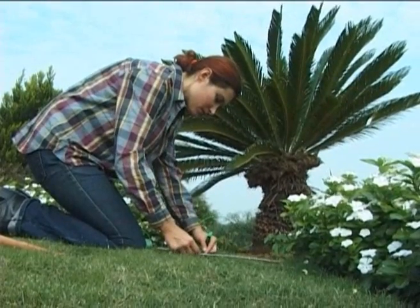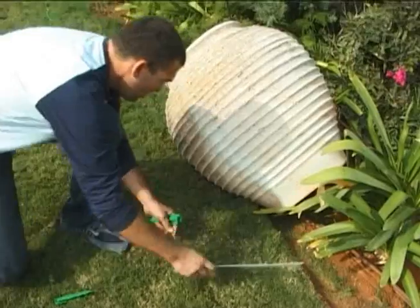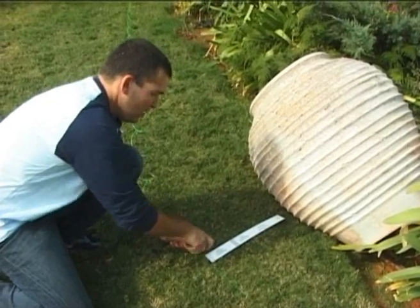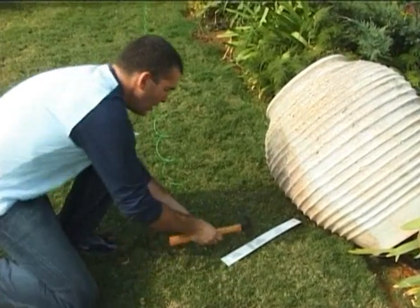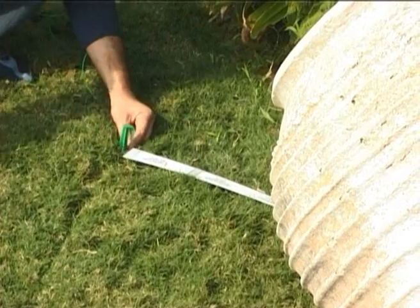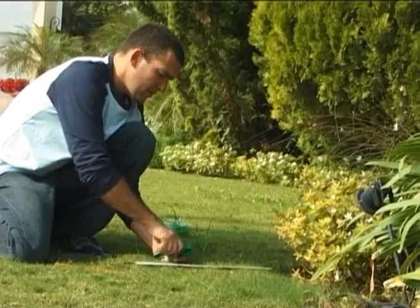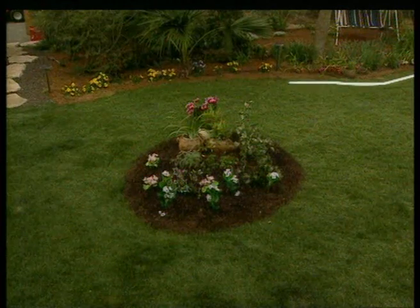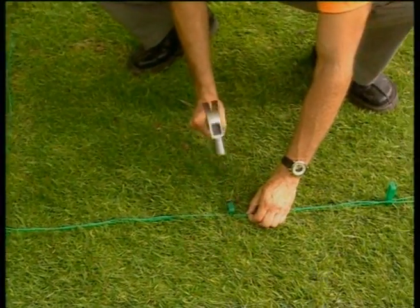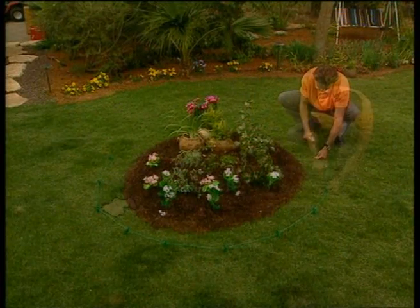It is essential that the peg's head is hammered below ground level. Use the entire length of the robo-ruler as wall edge as shown. Remember that you will want to test the wire setup before you fill in additional pegs. Use the robo-ruler for accurate placement of the wire when bypassing obstacles at the lawn edges.